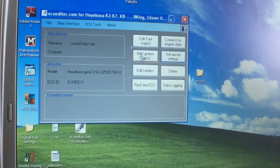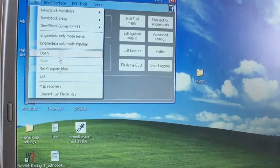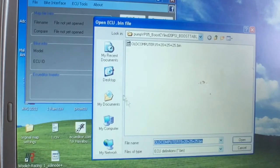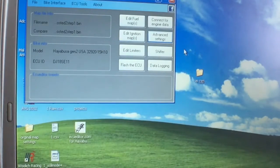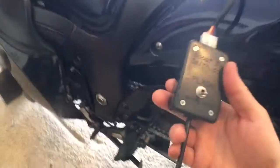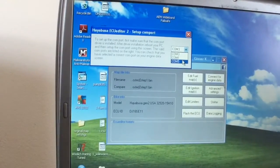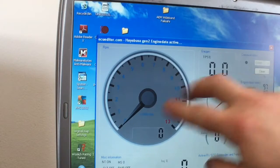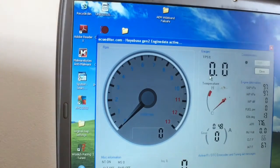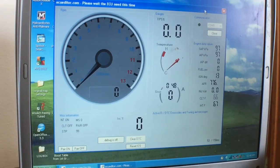Now that we've saved it, I'm going to completely reopen ECU and just make sure the changes were correctly saved. Go to advanced settings, drag tools — yes, everything's saved. Now we'll power it up and reconnect to engine data. Make sure you're on the right COM port before you flash — you'll know you're on the right one because you'll get a green indicator up here when communication is established, and when you adjust the throttle you'll see the throttle change. Always check that before you do a flash or upload a map.